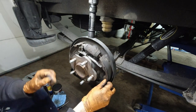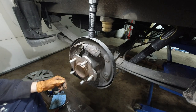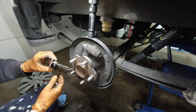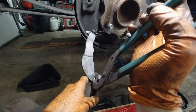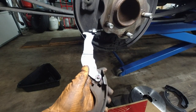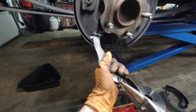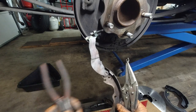Now I can take this side shoe off. There's a lot of brake dust here. This side is a bit different because it's got a C-clip in there, so now we've got to remove the C-clip. I take these big pliers — squeeze it out. I guess I did not need those other pliers I had ready.